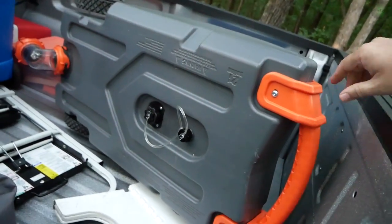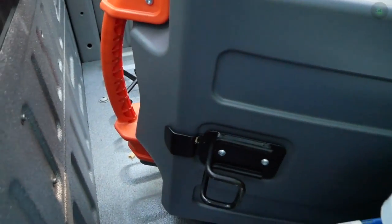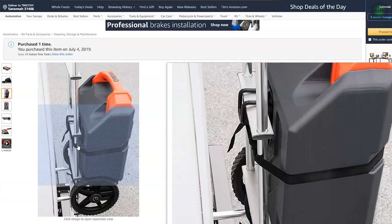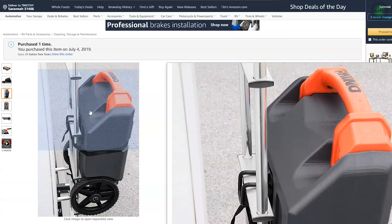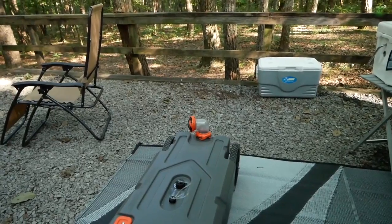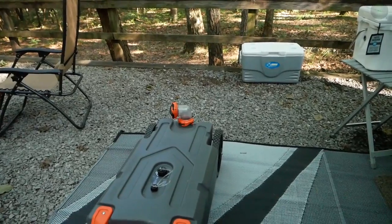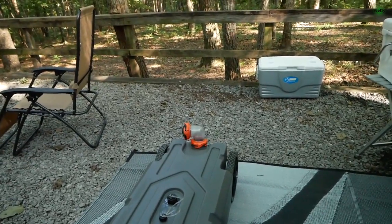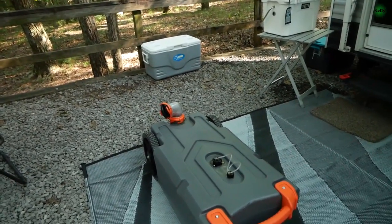Look at how light it is — it just goes right here in the back of the truck. Attached to it is a ladder hook that makes for easy transportation and storage. If your RV is equipped with a ladder, you can hook this onto the ladder and strap it down. These portable tanks — sometimes called cartridges — are only for gray water. They are not meant for black water, so do not attempt to dump black water in these. It's very unsanitary.